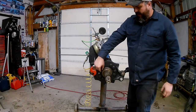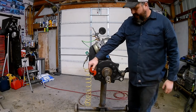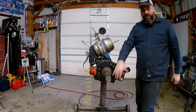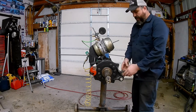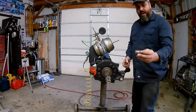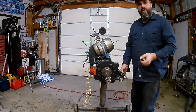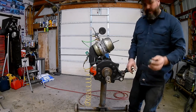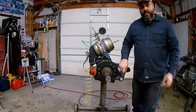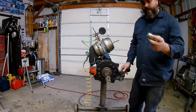We're down here pretty good now. We just have our S-cam left in there and we have these two pins over here called the anchor pins - this is where the shoe rides. These slide right out normally. If they're rusty or frozen up in there, you have to use a ball joint press, anchor pin press, or a really good air hammer to drive them out. It does have bushings in there, so if you do have to drive them out, replace the bushings.